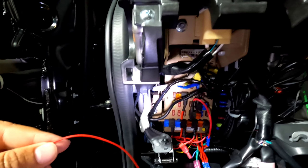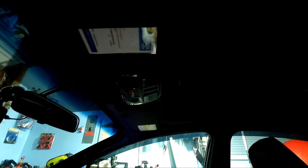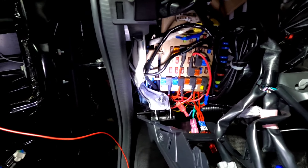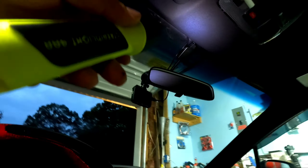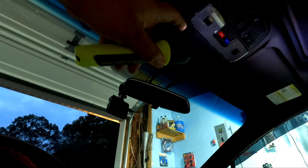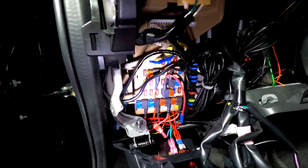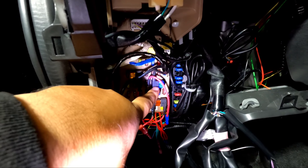The red wire is going to have constant power to it, and the ground is attaching to that wire which is connected to your dome lights and map lights — like when you walk close to your car. Another way to do it: connect the ground wire to a ground on the body of the car, and route the red wire all the way up the A-pillar to the middle up top. There's a cluster of wires running into where the map lights are, and if you tap in there it'll give you the same effect. I will test the wires and show you what they're talking about with this seat heater fuse.